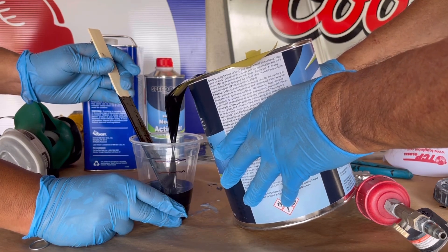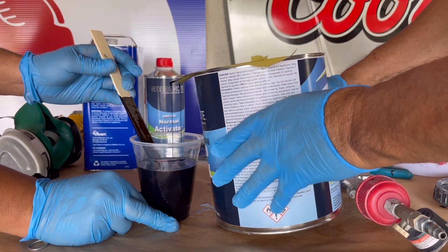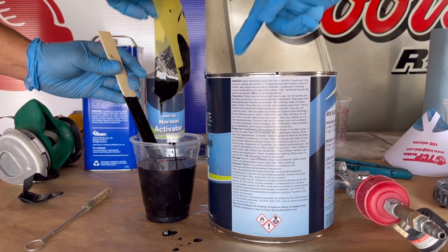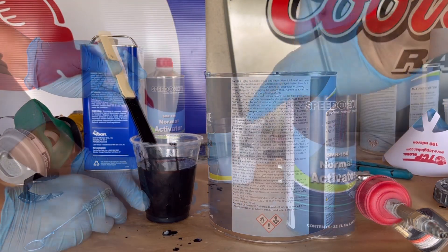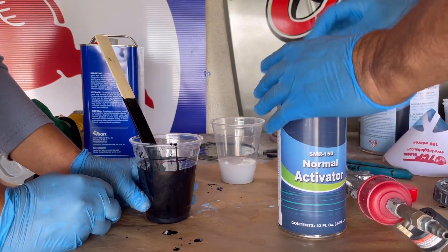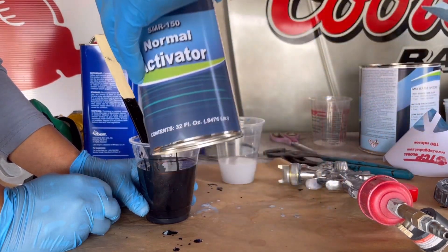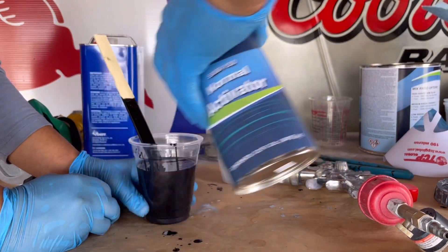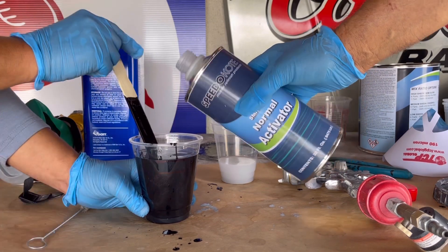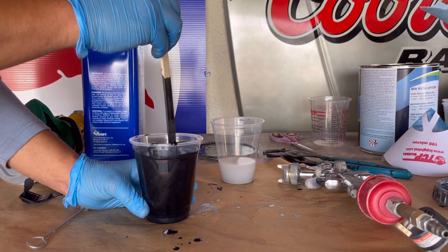After the primer, I used one quart of primer on the trailer. The topcoat paint is also a 4:1 ratio with no reducer applied — it's a really thin paint so you don't want to add any reducer. For both the primer and the paint, my PSI on the Harbor Freight HVLP gun was about 28 PSI. Test your fan pattern and make sure you get a good spray.